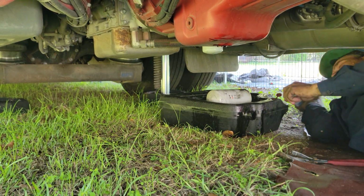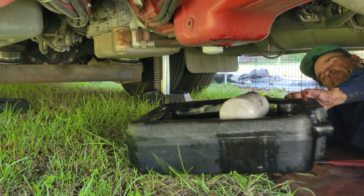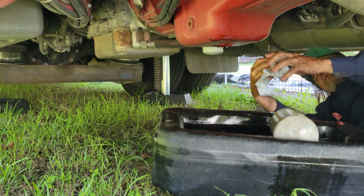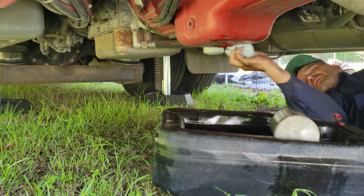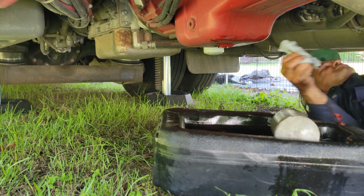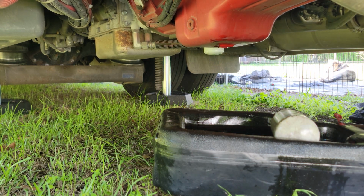We're golden. All right. Now we've got our oil filter up there preloaded. We've got our fuel filter on, it's preloaded. And we're going to put our oil plug back in the oil pan. Very important step. Don't forget the oil plug. And we're going to put that back in, snug it up there good too. And then we're going to go to the back of our motorhome to put in 16 quarts of oil.